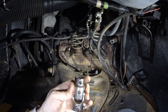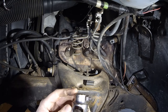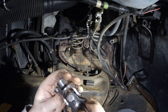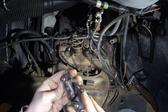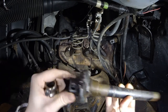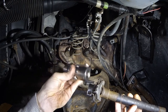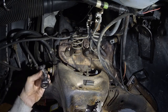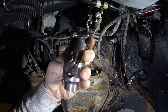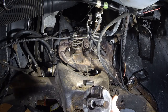I bought this especially in the States for a lot of money. I'll send an email to Flaming River to ask if only this part can be exchanged since the other part is okay. Looking at the existing rack joint, there's some play and flex — it's not that bad — but this Flaming River piece is just much more beefy and solid, and it looks a lot better too. This one is unfortunately too big; I need something that fits. I believe this is a 36-spline, and that one is fewer, so I have to count the splines and see how they line up.